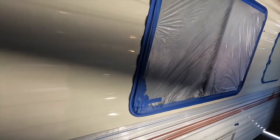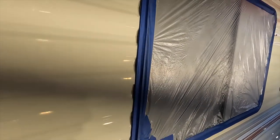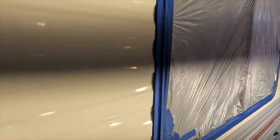Look at this test sample of the paint we're using. My customer came up to me and said, hey, I got some new paint — they said I don't have to sand it and it'll stick to my trailer. Well, there has not been one trailer that I haven't sanded. And even if I don't sand it on any kind of paint, even if it's sealer or something that actually grabs into a panel, if I don't have it scuffed, it comes off.